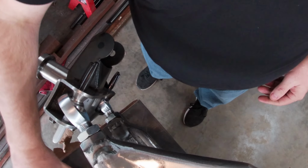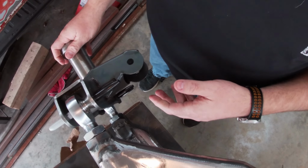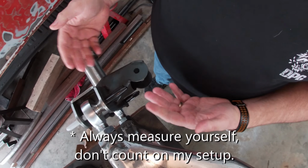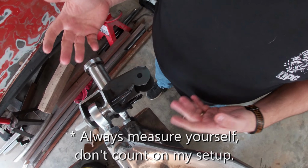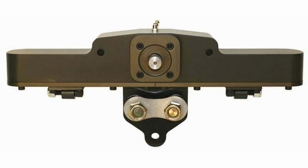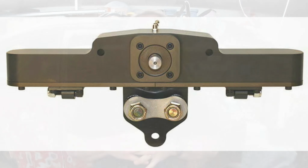So that is what I'm doing. And oddly enough, if you have this type of arm from Apple Tree or Cartech, you'll be able to use a 4-inch ram too. All right, well, that brings us to the end of this video. The key takeaways for me on this video was, 1, you want a center load front steer steering rack if you're building an A-arm suspension. If you're building a beam suspension, a center load bottom steer rack should do just fine.